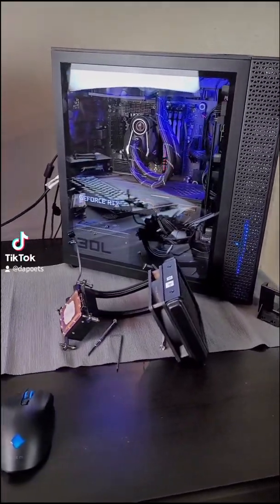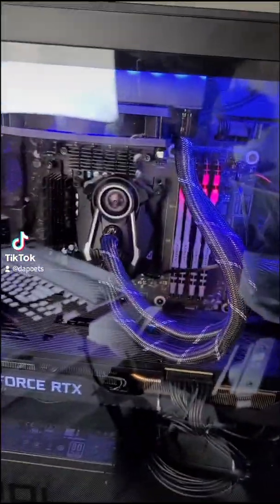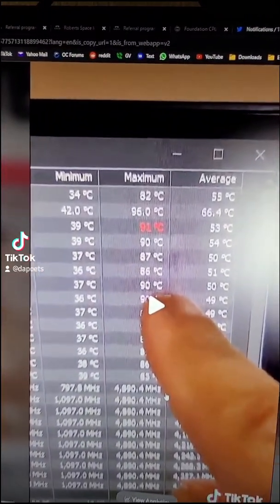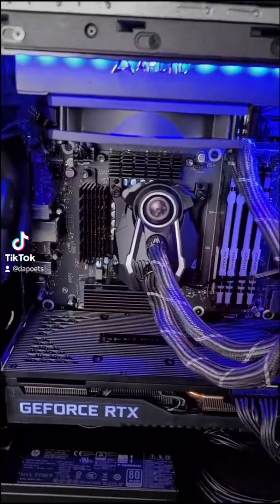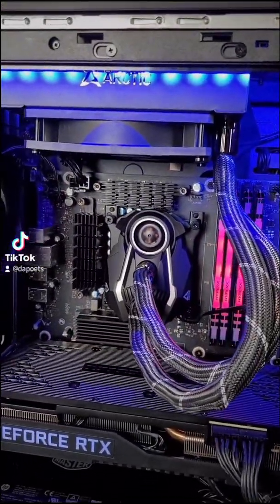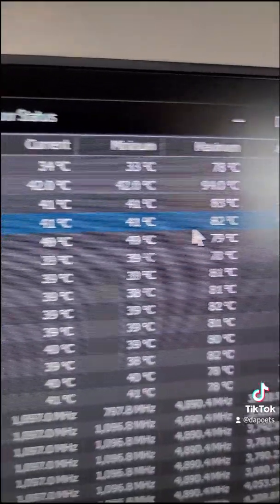Five degree drop, zero thermal throttling. For the HP Omen 30L, here are the Time Spy temperatures. With the stock 120mm AIO, the maximum temperature was 91 degrees Celsius. For the Liquid Freezer 2 by Arctic — a 120mm AIO cooling an i9-10900K — the maximum temperature was 82 degrees Celsius. A nine degree difference, same conditions, same ambient temperature. Arctic is just an amazing company for AIOs, and the 120mm has proven it can easily handle an i9-10900K.